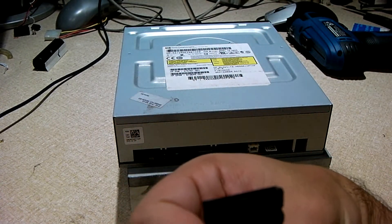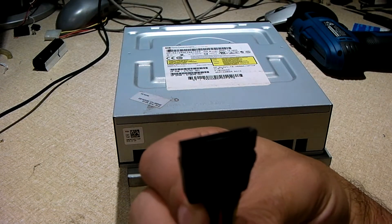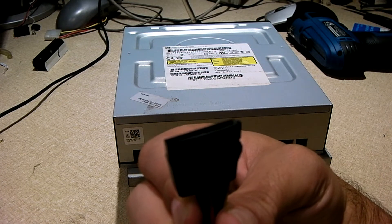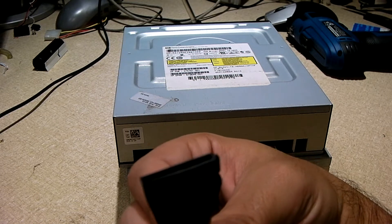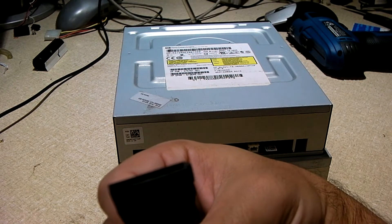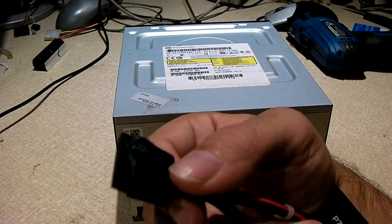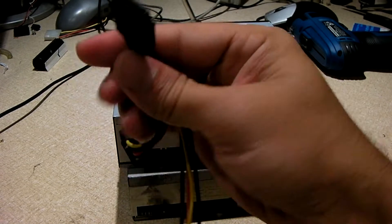So essentially, I think what happened here is due to HP's design of feeding the motherboard straight 12 volts and having the DC-to-DC conversion on board, the DC-to-DC conversion in the 6000 apparently did not have proper short-circuit protection. This is just absolutely crazy — a fire hazard in my opinion for anybody who's using an HP 6000 Pro. Just be warned.